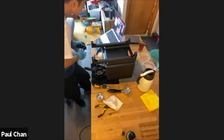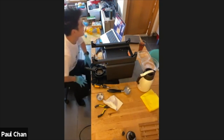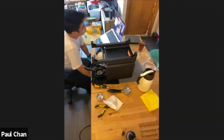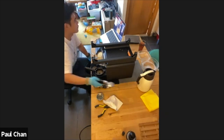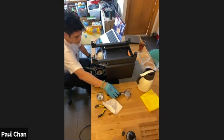There's a question: how frequently should we take out the brushes and do some deep cleaning? Okay, so I gauge this from our commercial cleaning schedule, in that each machine was probably doing 300 coffees each day, and we would deep clean that every night and then put all the parts back in the morning. So this would include soaking of the portafilters in Puricaf, all the baskets, all the screens, and that was it, because it was a standard E61 machine. But you can